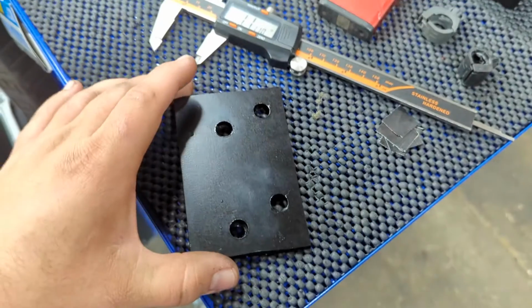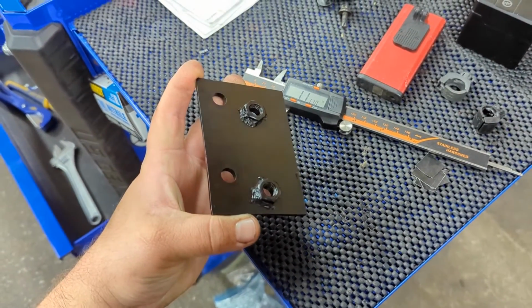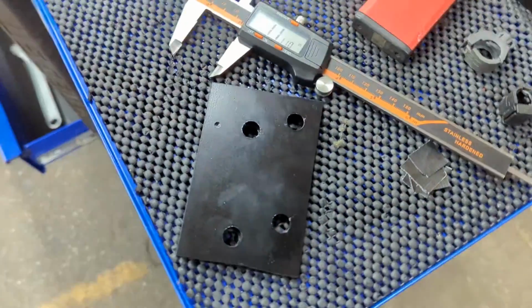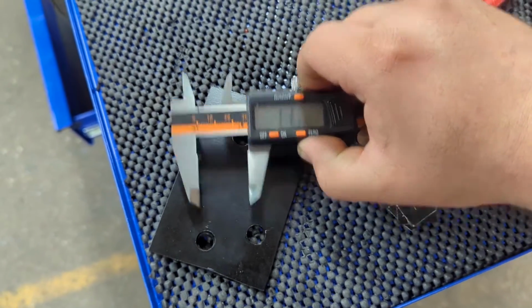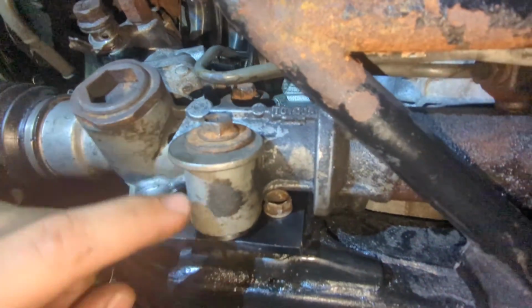Next is the power steering rack bracket. I had all that material laying around. It took some time to make that bracket, but it is necessary, I think, if you're going to put headers on the 1UZ. Now you can make a custom header to avoid doing this, but I've been driving the car for a few months now, a couple thousand miles, and I've seen no ill effect from relocating the rack. So that bracket that I made was made out of some pretty heavy-duty steel, and it did take time, but I had all of it laying around, so it didn't cost me anything.